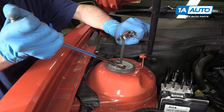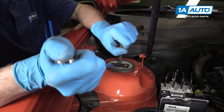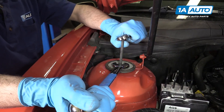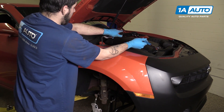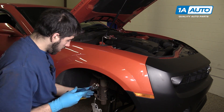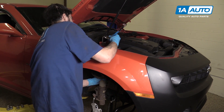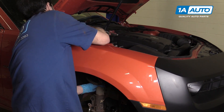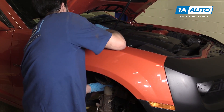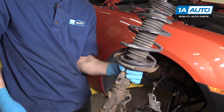You could also usually remove these with an impact gun, which works pretty well, but if you don't have one you can also do it manually. Once you're right about at the end of the nut, use vice grips braced against the hood strut and hold the strut with the other hand to finish backing off the nut on top. Once that's off, pop out the Allen key, remove the nut, and remove the strut from the vehicle.